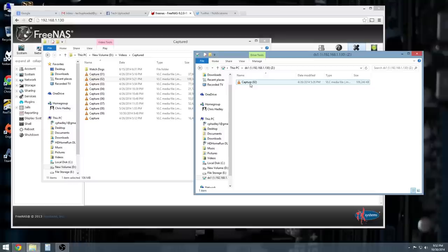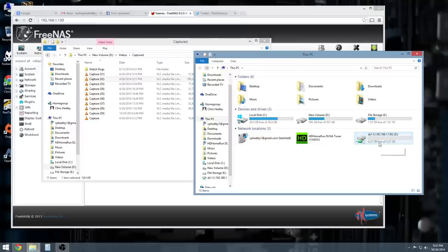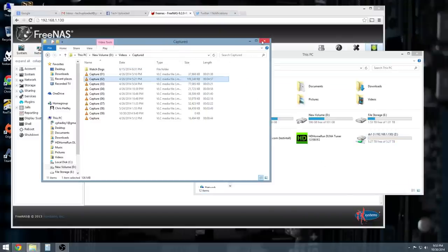I muted the TV and dragged a large captured video file over to the FreeNAS drive. Look at that — running at a very nice speed on a gigabit network. It dropped that file over super fast. Video is playing smoothly off the FreeNAS box. I have 5.27 terabytes available. All in all, pretty painless setup — I did have to remember the quirky USB 3.0 thing and turning on RAID mode, but I didn't have to do any reinstallation. I just plugged the thumb drive into that internal header, it booted right into FreeNAS, and once I created a new volume, I got a clean start and can start copying things back over.